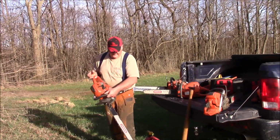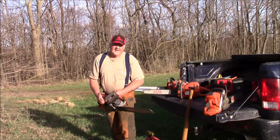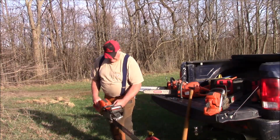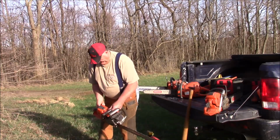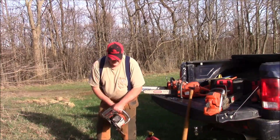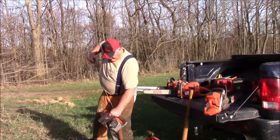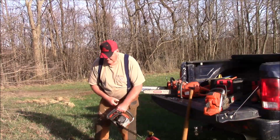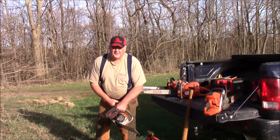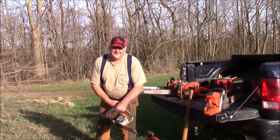This is the 24-inch bar saw that has the thinner base gasket with a pop-up piston. Some minor mods. Let's see what it does. It's going to have to adjust to a new temperature. Figure I'll let it run for 30 or 40 seconds idling, and it'll tune itself for the low speed. Then after about 30 or 40 seconds in the cut, it'll tune it for high speed.